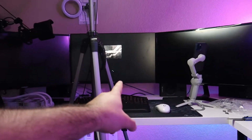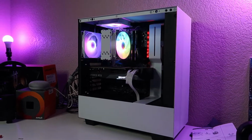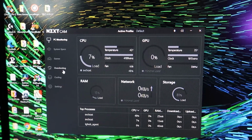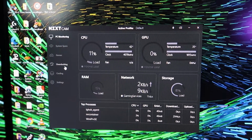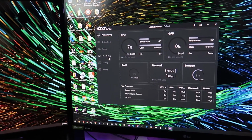Posted. Machine is on. The fan is not on at all on the CPU. Temperatures are going up, which is not good at all because there's no fan moving the air through. The machine is not picking up the fan at all, so I'm not sure why. Let's try plugging it out and plugging it back in.